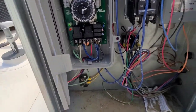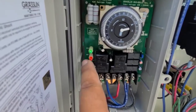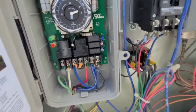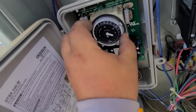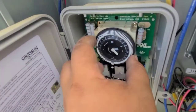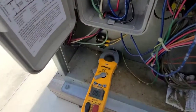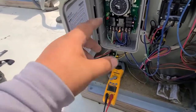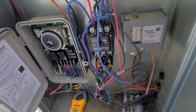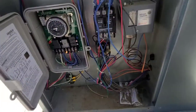Or regardless, if it reaches 45 minutes, it'll come on — whichever comes first. And then this one has the LED to indicate refrigeration — the red one would indicate defrost is on. So right now it's in refrigeration. Now I'm going to initiate defrost. The red light is on now. The unit's going to pump down by itself — it's going to close the solenoid and shut off via a low pressure switch. That way you don't have cold refrigerant in the evap while it's defrosting. That's basically the defrost clock.